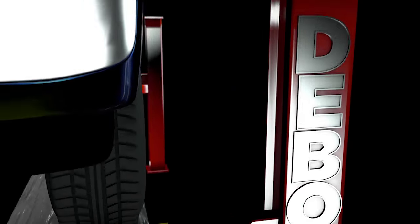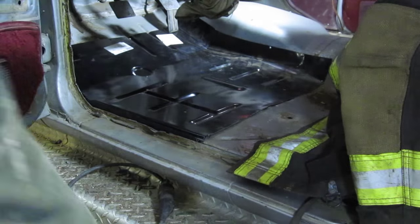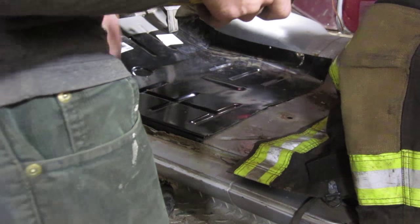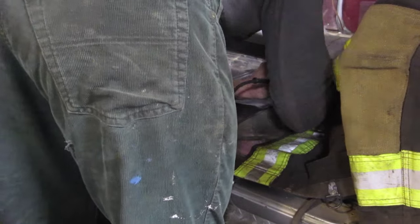I like using these really thin zip cuts — it's about the width of the spacer that lines up the floor. Trim it really nice around three edges, then remark it, stick it in there, remark it, then cut the last one with the sheet out. When you cut, make sure you're nice and tight up against the steel. Even if you cut into the steel a little bit you still get a perfect cut all the way along — just don't wander off to the right. Stay nice and tight up against the steel.